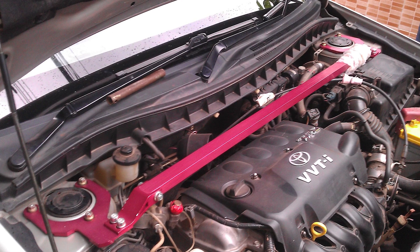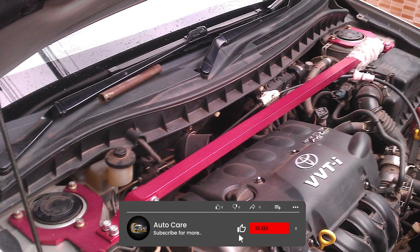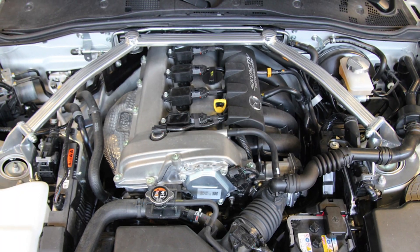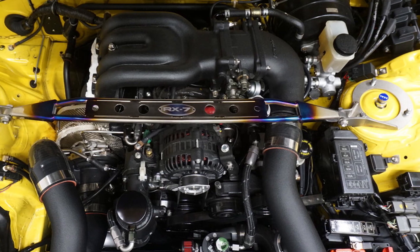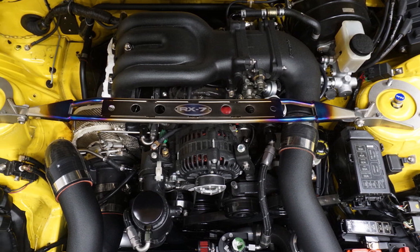Plenty of cars, such as the 2023 Nissan Z, come with strut bars from the factory, but all cars can benefit from them. Unlike stiffer suspension, a more rigid body only benefits the car. It increases ride quality by reducing uncontrolled motions and also improves handling by making the body less twisty, which helps with turn-in and direction changes.